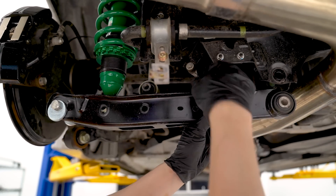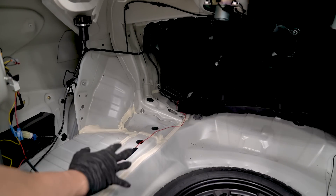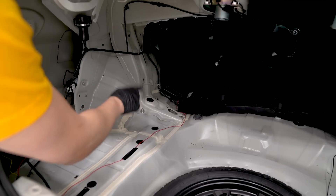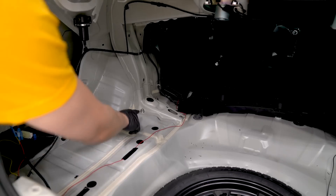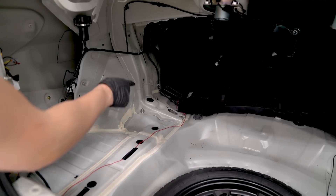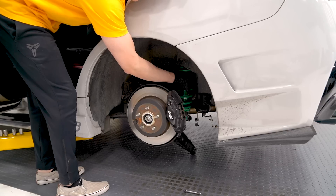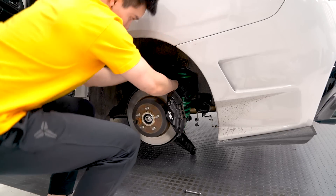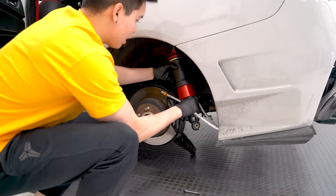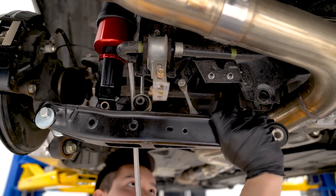With those removed, we can pull the lower control arm down and then go up top to get the strut off. Inside the trunk, I've removed basically everything to give us more room to work with — it's really easy, there are just some retaining clips you can remove with a flathead screwdriver. We're going to need to do this anyway to route the lines. There are two nuts holding in the rear strut. If you're doing this by yourself, remove the rearmost one, loosen the other a bit, open the rear door, keep one hand on the strut, and loosen off the last nut, then pull the strut out. With the old suspension out, we can slide in the new airlift suspension, then go underneath and get the lower control arm back into place.